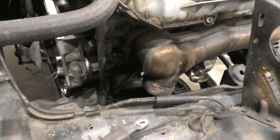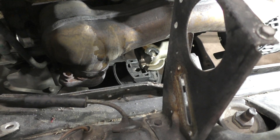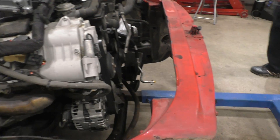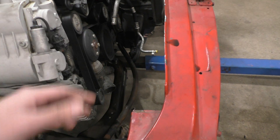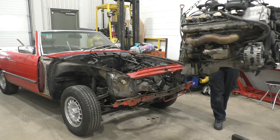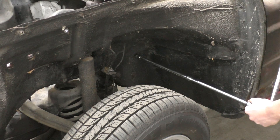One obvious thing is all the steering stuff is right underneath the oil pan, so that obviously needs to go — luckily that was something we were removing anyway. What's not so lucky is that the subframe also needs to be cut by quite a bit. The engine mount brackets will need to be modified; we think we can keep the original engine mounts but the brackets don't line up. For the radiators we'll need to cut the frame about five centimeters wider to fit all the radiators in. The steering system bolts were so badly seized that fire would actually come out of them every time we untorqued them.